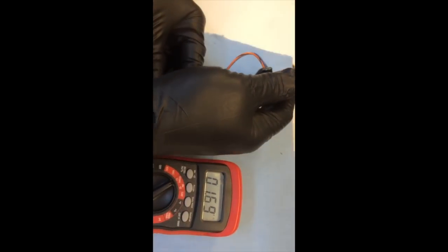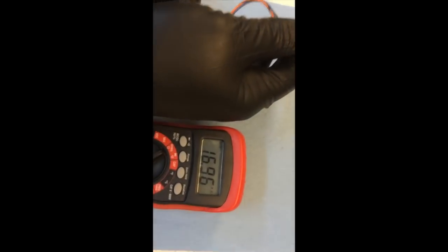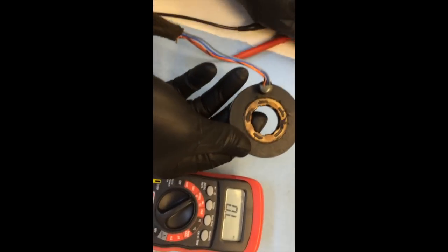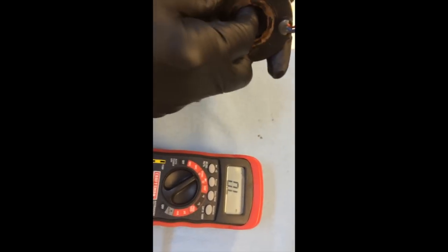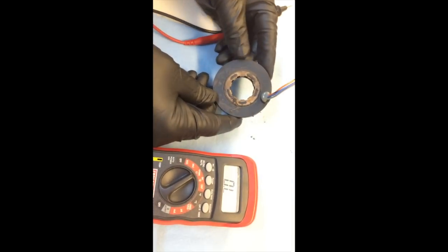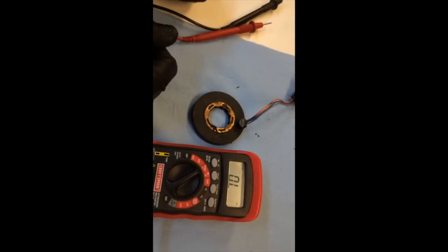A new one should — there we go, I kind of squeezed it there — and you can see we get a little bit of a reading out of it. 16,000 and 17,000 ohms is way off the scale of what we want. This particular sensor is the original one from 1998 and should have been replaced ages ago. From what I've seen, they typically don't last any longer than maybe 45,000 to 50,000 miles tops. This particular truck has 280,000 miles on it — long overdue.